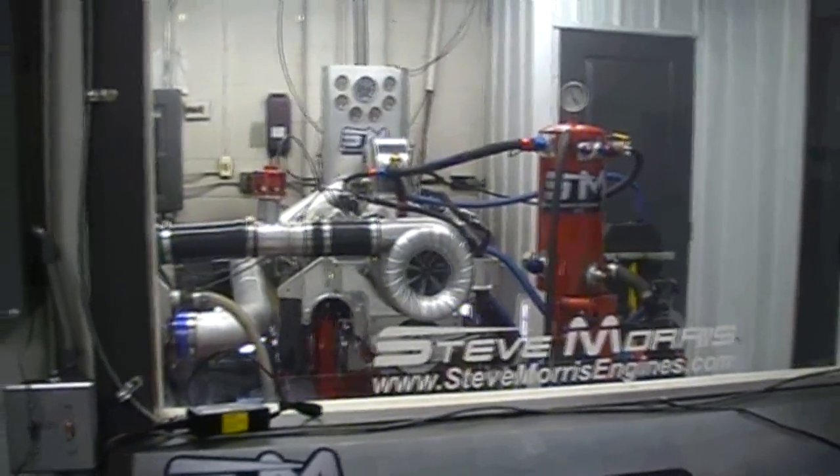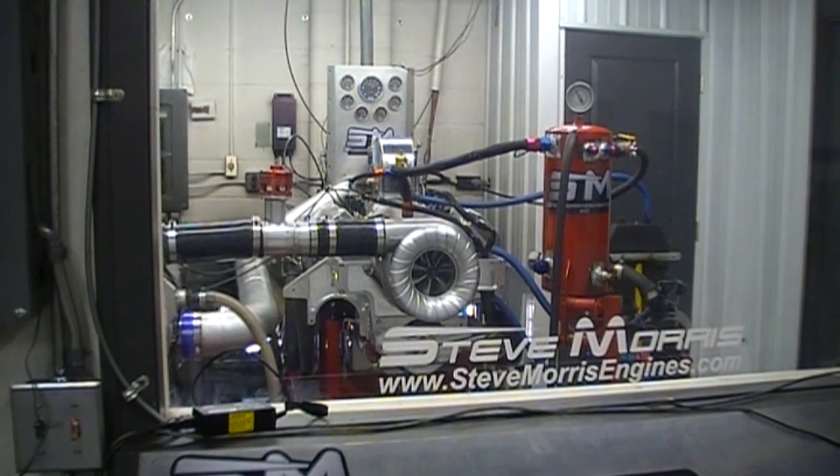We're back with 5-inch piping 136 with the ProVolute Bell. I'm going to be working on some internal modifications, but honestly there's a lot less to do on this housing. Internals — I'm not 100% sure yet, we'll work on that. We're not just doing clearancing — it's total CNC machining of the entire landing area of the blower. So it's not just tightening up clearances. We're working on a profile; I've got one kind of started and we'll see if it makes any differences. But like I said, this is pretty good — there's a lot less room to improve.